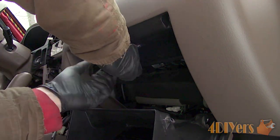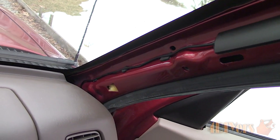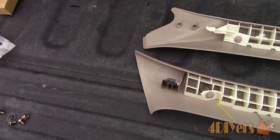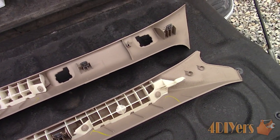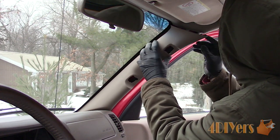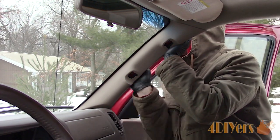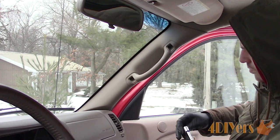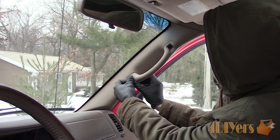Don't clip the glove box in just yet. Here's a view of the WiFi antenna before the pillar trim gets installed, and a view behind the pillar trim as a reference — this is both the driver and passenger side. Snap the pillar trim back into place, push the door gasket back into place, reinstall the pull handle and tighten the two 10mm bolts, then install the two fastener caps.